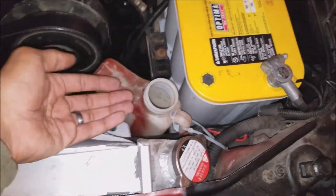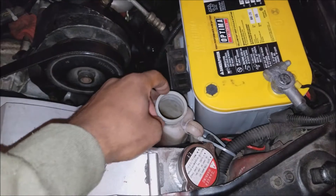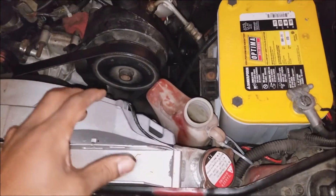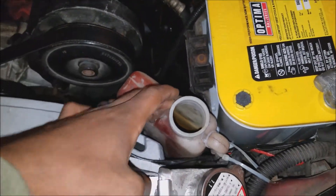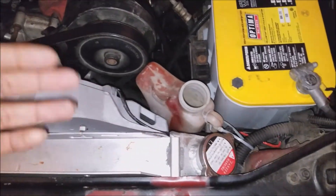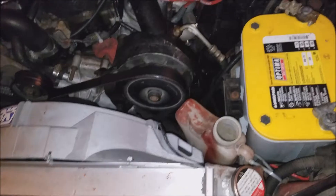There's actually a drain, so when the liquid gets all the way to the top it starts to spill out. This cap is basically not airtight, and that's important. The expansion tank is there because that extra liquid needs somewhere to go, and it needs to be able to go in and out — it can't do that if it's airtight. If it spills out and then tries to take in more than what's left, you're going to get air bubbles in your radiator and have issues keeping your car cool.